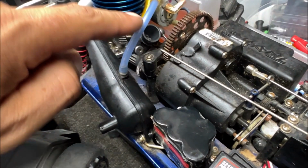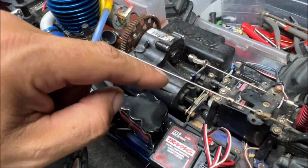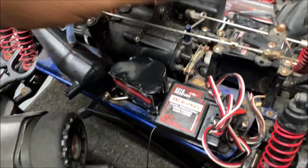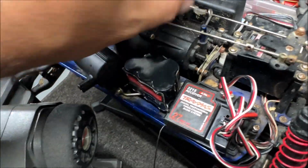This carburetor was way out of whack, and this throttle linkage and brake are way out of whack too. They had the brake tightened down so tight, you can see how it was squishing that little rubber thing, and that's just how they had it running with the throttle in neutral. Squished down brakes. So immediately unhook that, give them a rest.